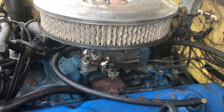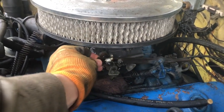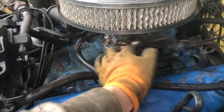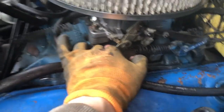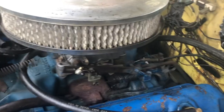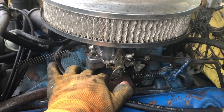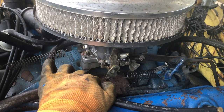What we are looking at is this whole assembly here. This is your kickdown linkage, which, as you can tell, does not work very well. This is my throttle return spring — one of them — which obviously isn't doing a lot. And this one, as you can see here, doesn't return anything. It's not connected to anything. So this assembly is coming off — new throttle cable and new spring — but we're putting a nice new bracket on here as well. That is pretty much the whole assembly here being replaced. It will also look a lot nicer.